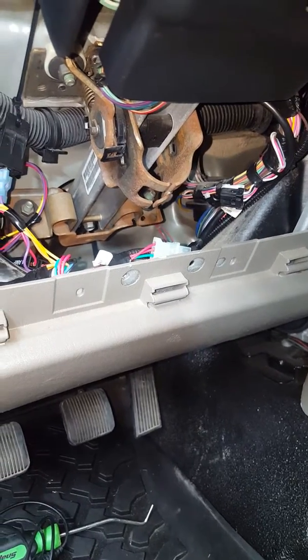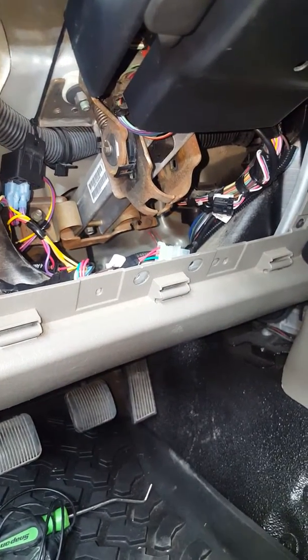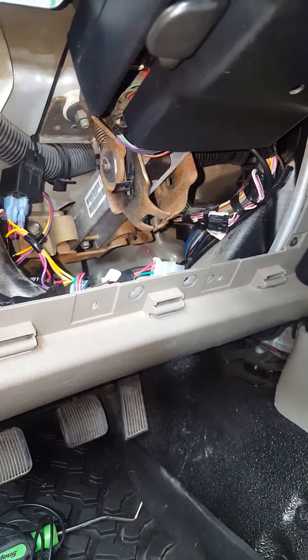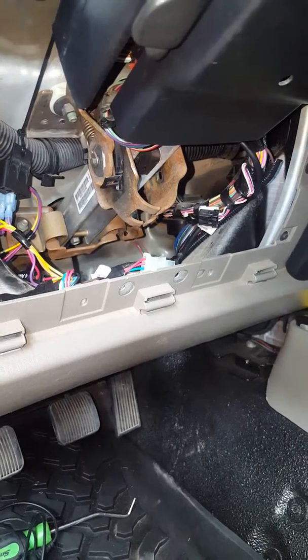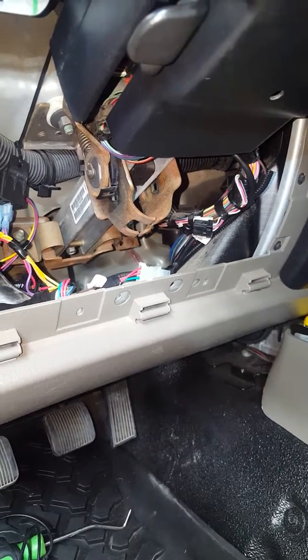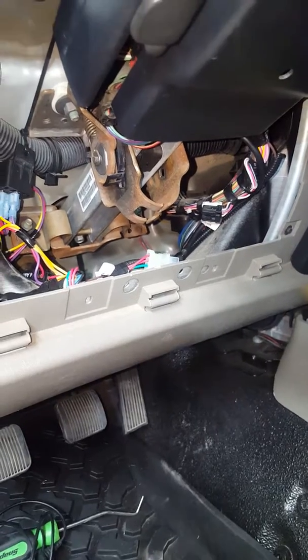I know that on these Jeeps like this, if they have the 4-cylinder, I've run into them where you have to use their 250-4369, which is a pulse module that takes it down to 8 or 10,000 or something instead of 38,000. So if you're doing the 4-cylinder, be leery or aware that you're going to have another $40-50 in that part as well.